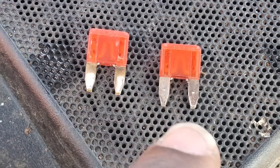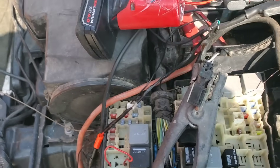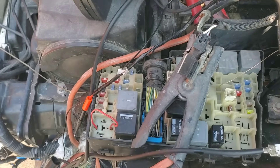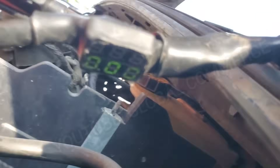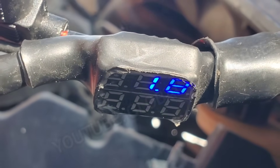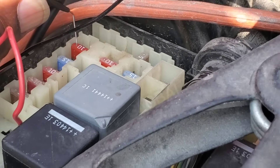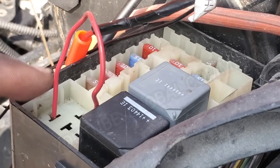Let's go ahead and put another fuse in there and see the difference. There's our bad one we took out, and here's our good one. I'm going to go ahead now and put that in. Right away I noticed there was some clicking going on and it stopped instantly as soon as I put in that good fuse. We're reading about 11.9 to 12 volts. So now it's passing current properly. Let's put the relay back and give it a try.